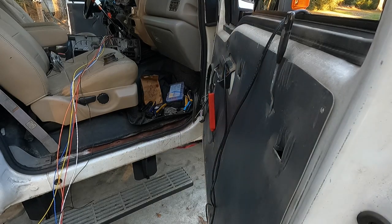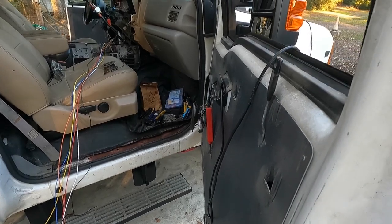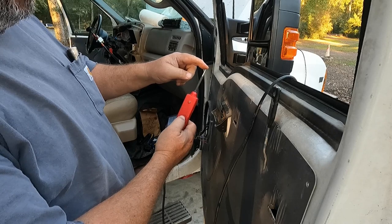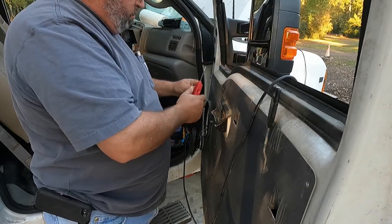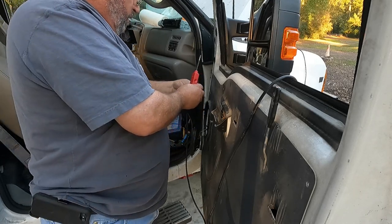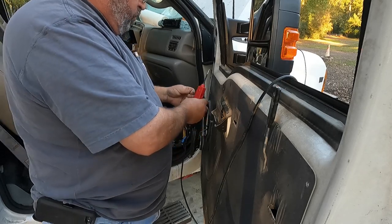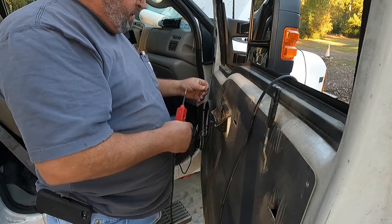We're running out of daylight and we'll finish the mirror stuff tomorrow. On the power probe you have a switch — when you go forward it's red, meaning the tip is providing hot; backwards provides ground. We're going to provide hot. On the side of the mirror we go to red, send it hot, and you can see the brightness — that's the top light. Then we apply hot to the blue and that comes on too, but dimmer. Blue is the running light on the bottom, and red is your turn signal which is the brighter one.